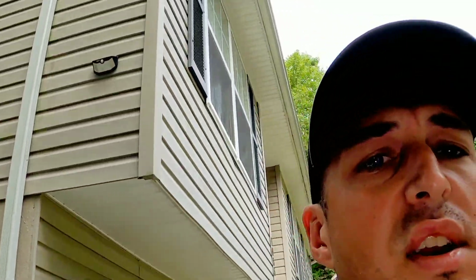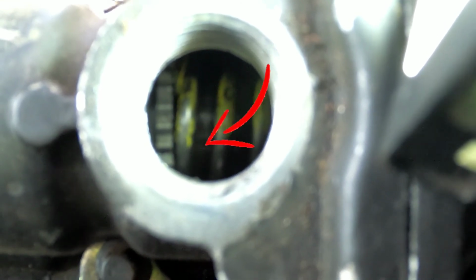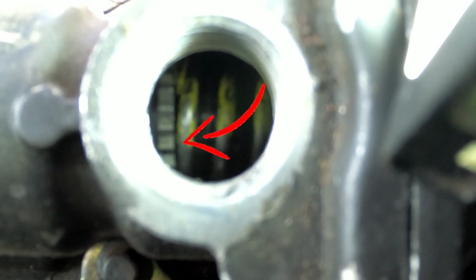Inside the pump, you can see your AFC spring. The furthest forward, again, the lighting is crappy here, sorry, there is actually the star wheel. So we're going to go ahead and adjust that down, like I said, about 6 to 8 clicks. All right, if you guys can see right there to the left side, you'll see the actual star wheel, and again, your AFC spring right there.